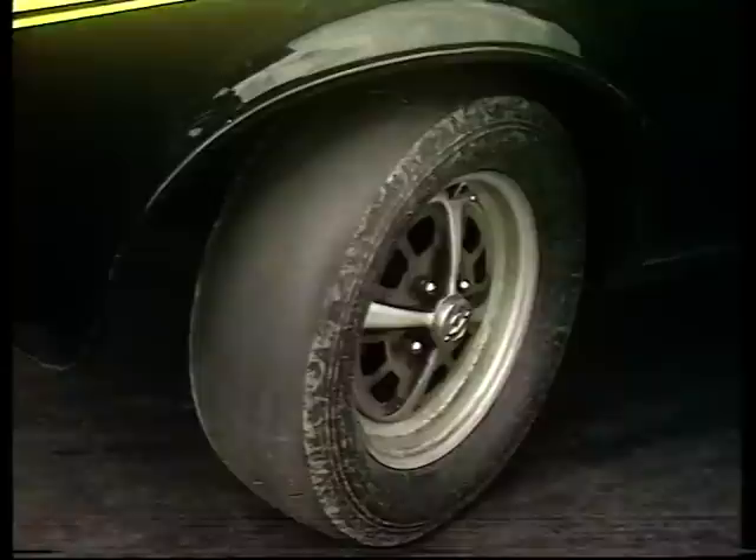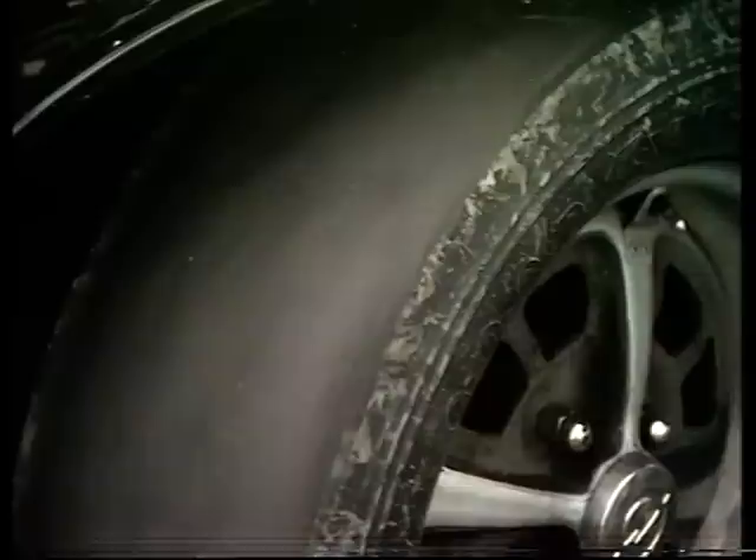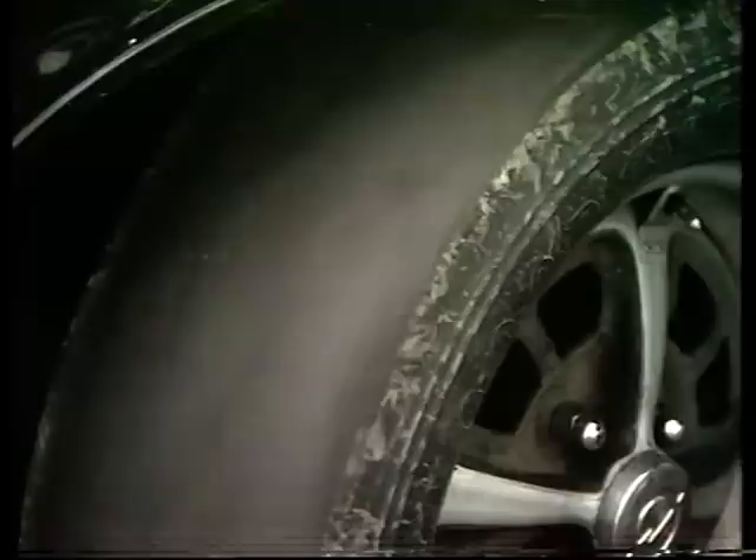But what's special about them that makes them so good in the dry and so poor in the wet? Well, the main reason why they grip the road better in the dry is because you've got more rubber in contact. When you've got treads in the tire, it means that there is no actual rubber touching the road. The tread pattern normally is for just draining the water away from the tire surface to allow the actual rubber to touch the road. So with a very flat tire like this, you get aquaplane? That's right, yes. You get a buildup of water between the tread and the road surface, and with the increase in speed, the pressure builds up and eventually lifts the tire off the road itself.